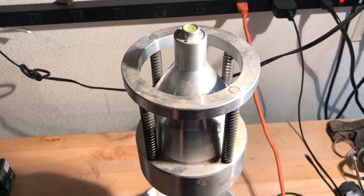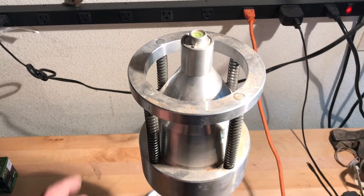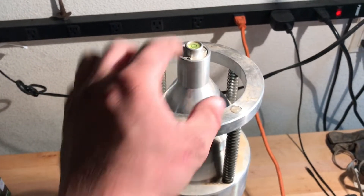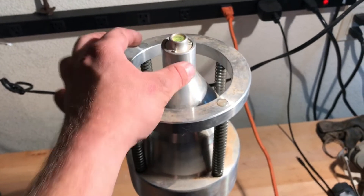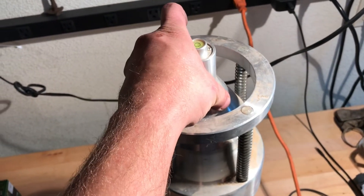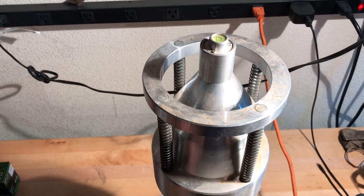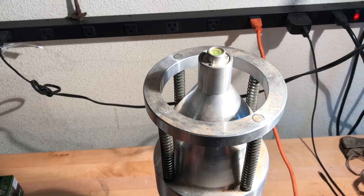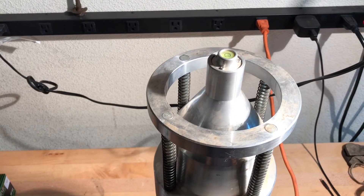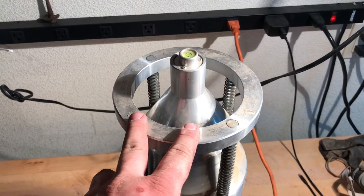The first pro is how accurate you can actually balance the tire. If you are properly inserted with the balancing pin inside of this hub, and you center the bubble, and you make sure your wheel goes all the way down this cone, you're actually going to get fairly good results. I've been able to take tires that the tire shop wasn't able to balance correctly — just because they're lazy or the machine's out of calibration — and actually take all the vibration out with this.